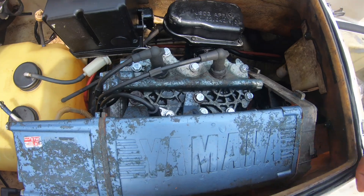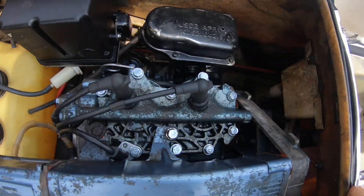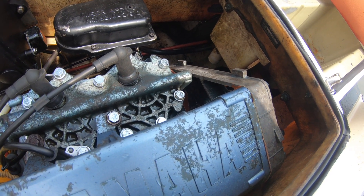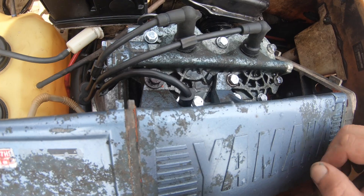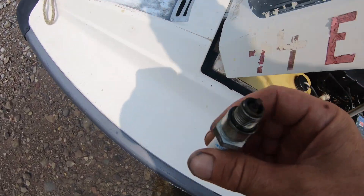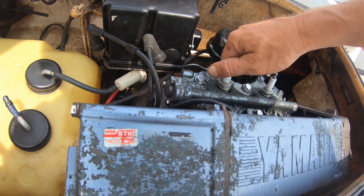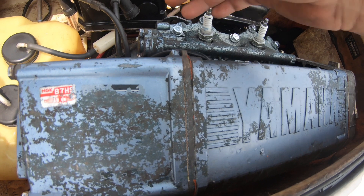Look at how rough this motor is. If you compare it to my other '88 500 — all the paint — this thing had a tough go, but we'll get it back. Somebody was in here with RTV sealant, and these are all new gaskets, but it looks like they buttered each gasket with RTV sealant, which I hate. The motor's holding up. I'm letting the head cool down a bit before I pull the plugs, but I'll check the color. To me, that looks pretty good, but I wouldn't mind running it a little richer. It was white an hour ago, so let's give that a little snug.